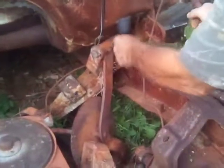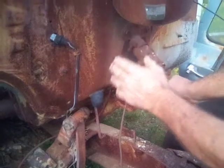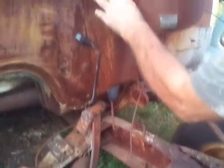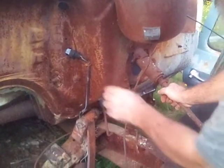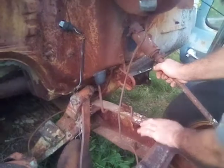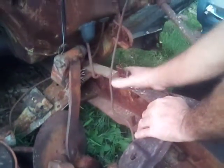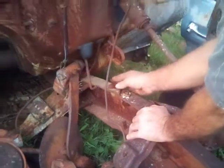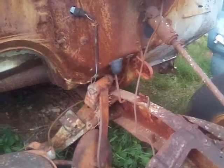Yeah, poke a hole in your floorboard for this pull rod. And you can get the clutch pedal, linkage, and all that out of a 63 through 66 and put it in there and change that over from a hydraulic master cylinder clutch release to stick shift. And you also have to get this bracket right here on the frame, on a 60 to 62 or automatic if you're going to V8. You have to get this frame bracket because your Z-bar hooks to that. You'll need that bracket.